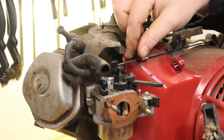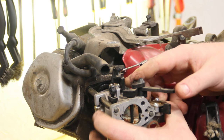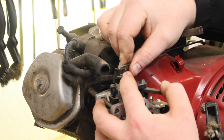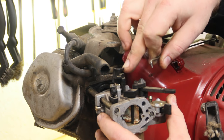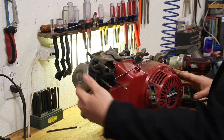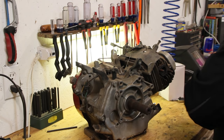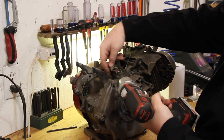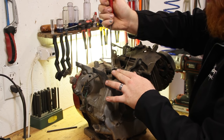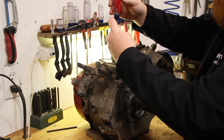On these rods it's pretty much the same way as on a Predator. If you pull the carburetor most of the way out you can push this back. If you slide that out enough you can slide that right up - there's a little lip you have to get it past to slide it out. So now we can remove that carburetor. Now I'm going to be removing the whole governor arm, which usually is a 10 millimeter. I always take a flathead and get down in there and bend that apart so it'll slide off a lot easier.